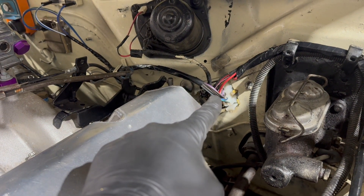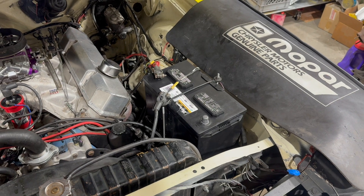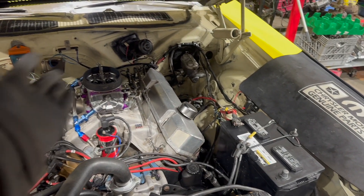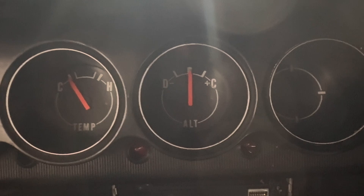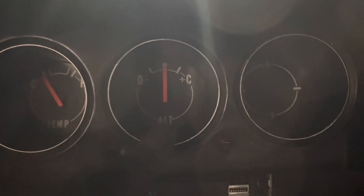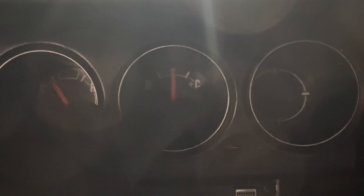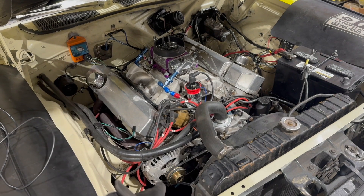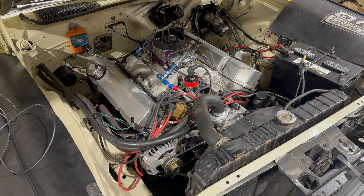The biggest reason is this: the bulkhead or firewall connector. The battery in your classic Chrysler powers the starter to get the engine up and running. Once it is up and running, the alternator's job is to maintain the charge in the battery, replenishing the amount of juice you use to start it, and then continue to run all of the accessories in the car. If you've ever had to crank your classic Mopar for an extended amount of time before it started, or had to jumpstart it with a mostly discharged battery, after it starts you're going to see this gauge — known as the alt gauge in Chrysler speak, or an amp gauge, or ammeter — all the way up on the charge side. That's because the battery is discharged and the voltage regulator is prompting the alternator to put out a bunch of extra juice, operating near its maximum output, which on most of these systems is only about 35 amps.